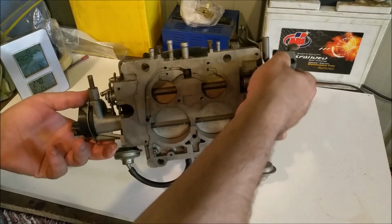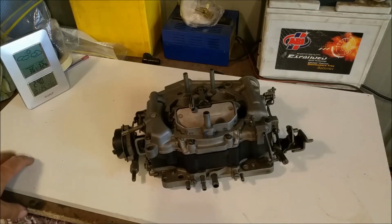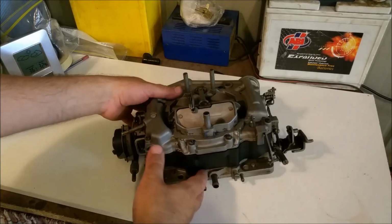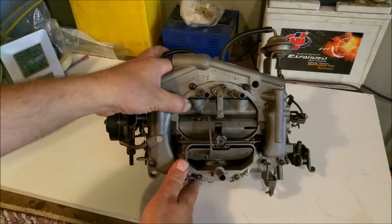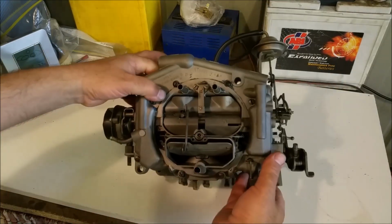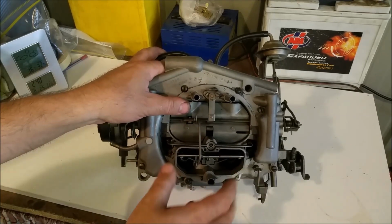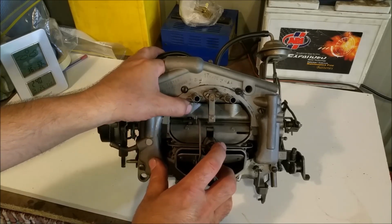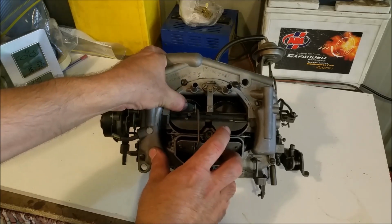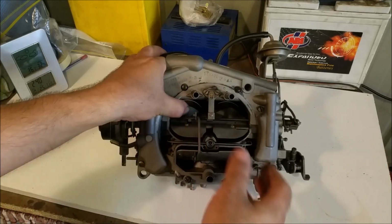Now, they're enormous, and we had them on 302 engines and 351s as well, which 351s I wouldn't be surprised with. Chrysler used them on 340s, but 302s you would think they'd be a little bit too big. What they have to counter that, when you open up those huge secondaries, of course you lose all your airspeed. They also have this damper here, and what that does is it removes the shock of opening the secondaries and losing all the air. And of course, once vacuum's allowed to start commencing, this door opens up and there's two secondary spray bars in there. And of course, then it starts drawing fuel.